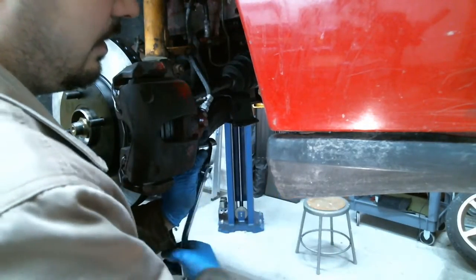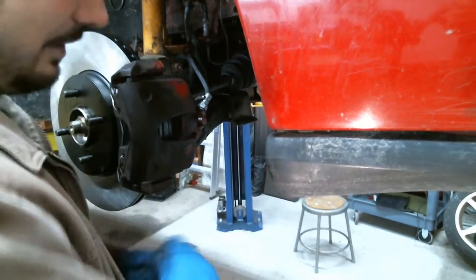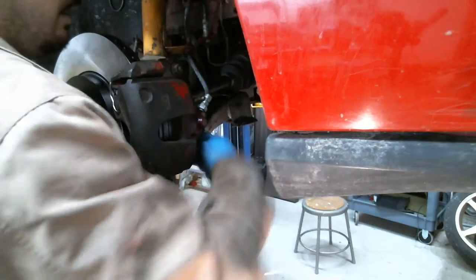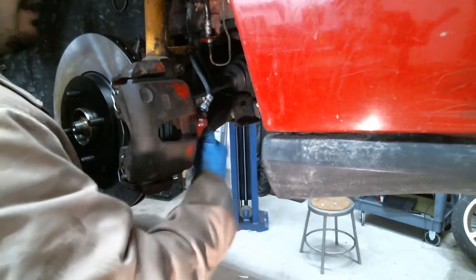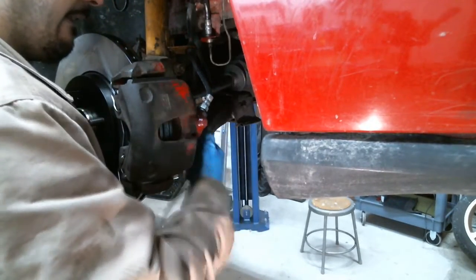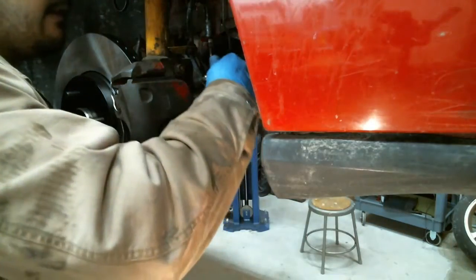Tom says, I always forget that damn spring clip and have to take the wheel off again. Yeah, it is a pain in the ass. It sucks. And Broncos boy, did you drop the axle yet? Just joined. Yeah, man, it's done. We're pretty much wrapping up here. So we finished the axle. We just did the rotor. We did the pads. We put the caliper back on. Now we're just tightening everything up. We also changed the brake hose.